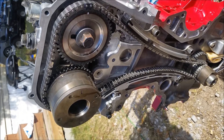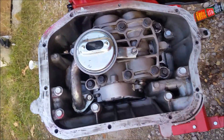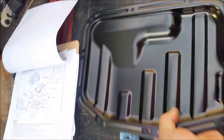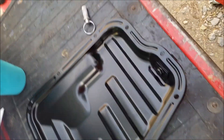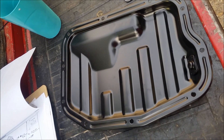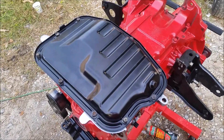The upper oil pan is on, everything's nice and clean, all torqued down. Now we just have to throw the lower oil pan on. I got a brand-new aftermarket one for 18 bucks on Amazon — the coating inside the old one was coming off, and I wasn't about to put that on a rebuilt motor since all that stuff would end up in the oil pump pickup. So the old one's trash. We'll seal the new one up, put it on, torque it down. The pan is on, torqued down to 60 inch-pounds.